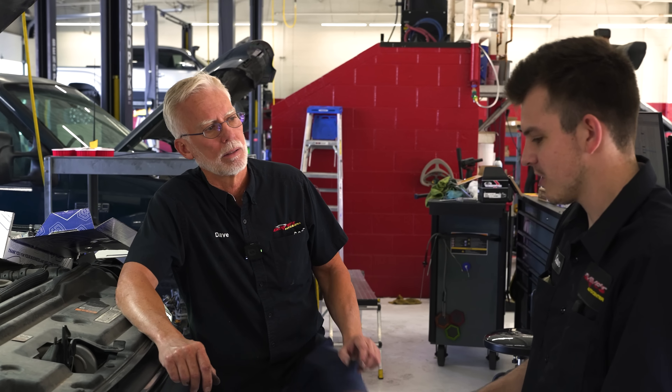You've got to pull the whole intake off? Full intake, yeah. And so what might we do while we've got that intake off? Check the carbon buildup, all the soot. Yeah, and we might want to take a borescope and look down that EGR cooler and see how plugged up that is.